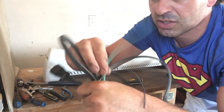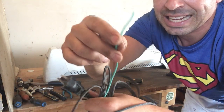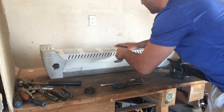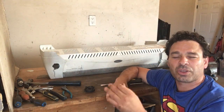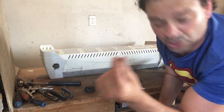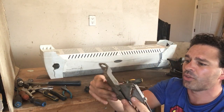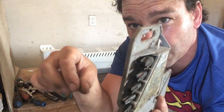You never know the little tips and tricks you're going to discover along the way. That only works when it has three cords like that and the one inner one is extra coated — just a small little cut there, easy to upgrade. The rest of this shell did have screws on the bottom that I had to remove. It also had two security screws or bolts. You will find them on a lot of items — they are put there for safety purposes on a lot of microwaves. Those bolts are called security bolts because they have inside them a small little nub. Buying one of these L-Key security sets has come in tremendous help for me. They are very handy and inexpensive — it only costs $10 and I use it all the time.